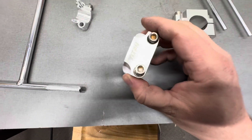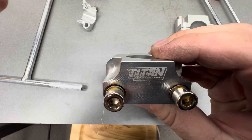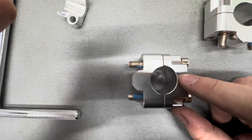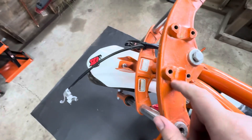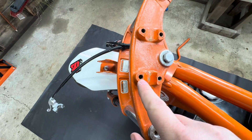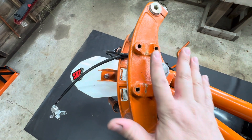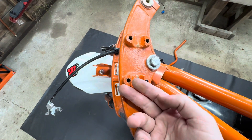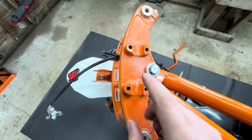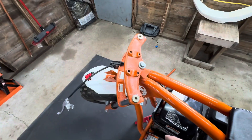Okay guys, so these are the Titan Racing ones — Titan Performance Parts. The hole is bigger, it's an inch and an eighth, so it's an adapter. Sometimes it's threaded all the way through, sometimes there's a post, but this is where the adapter goes. You're going to leave the existing threads and use them for the adapter. Normally your 7/8 bar sits in the groove, but now you raise it up just a little bit and there's an inch-and-an-eighth groove so you can put the thicker bars there.